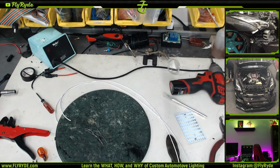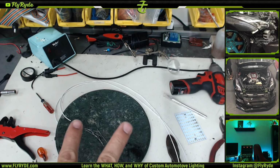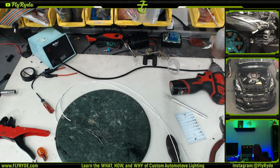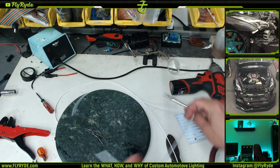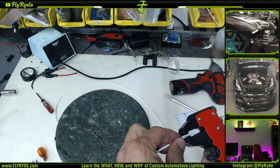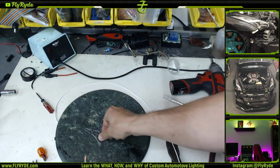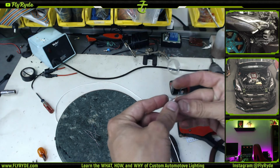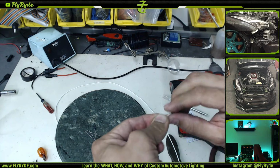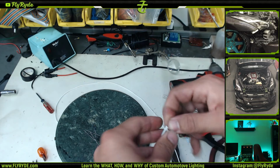Okay. So different brightness is not what we're going to do. We are going to make two different ways to power one thing. And why that matters is, for example, the strobe unit. If you notice, the lightning bolts on the car were strobing, right? But they also got powered by the running light. But when they were strobing, the rest of the running light circuit wasn't strobing, right? It's because I put a diode.